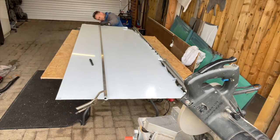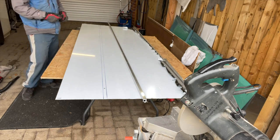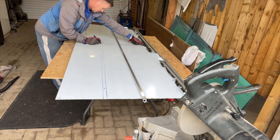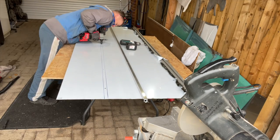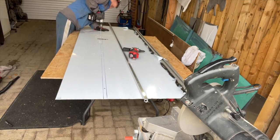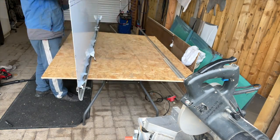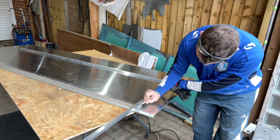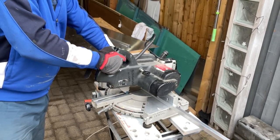I'll put a marker line from one to the other on this side so we know exactly where we're going to drill, and we can now go straight through into the box section through this front panel and rivet it all the way down. I'll line these up with the rivets on the top so it all looks nice and neat and all in line. Get the holes through and bang them rivets in. So if we're putting a few in here it's going to have an awful lot of rivets holding it all together by the time we're done — so I'm so pleased they've got that electric rivet gun. And we can cut these battens up, mark them with the pencil, cutting through with the mitre saw — makes light work.